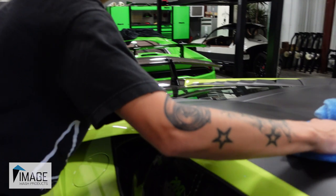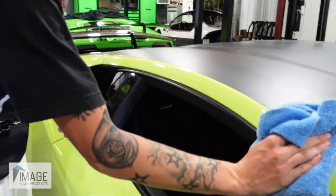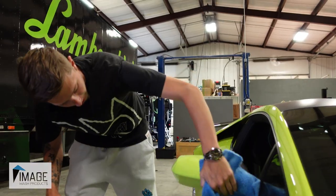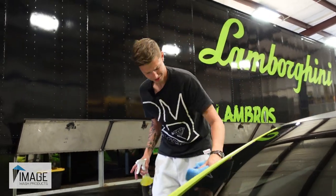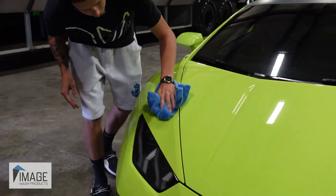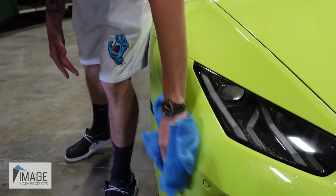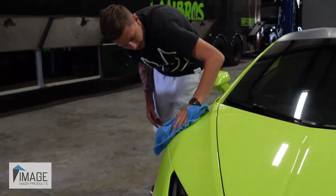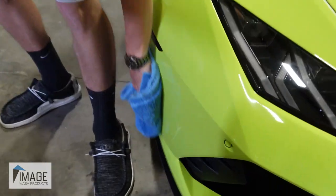What you're seeing Tyler do right now is he's using the quick detailer. It's good for a quick wipe down when your car isn't that dirty but you want it to look perfect. Great for last-minute wipe downs before a car show or for spot cleaning, which is pretty much what we're doing right now. It's going to leave the surface looking extremely glossy. It's a strawberry scent — we were trying to figure out what that citrus was, but it's strawberry. It removes recent water spots, but it doesn't remove heavily baked-in water spots or spots etched into your clear coat. It can be used on any exterior vehicle surface — you just lightly spray it on a clean microfiber towel, preferably the super soft blue ones that we are currently using.